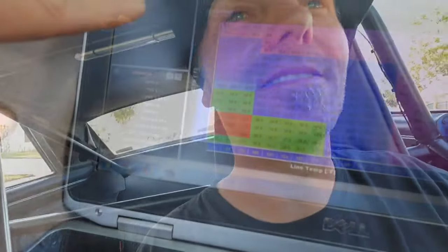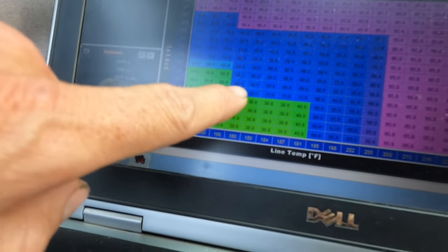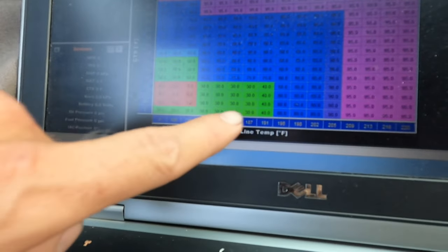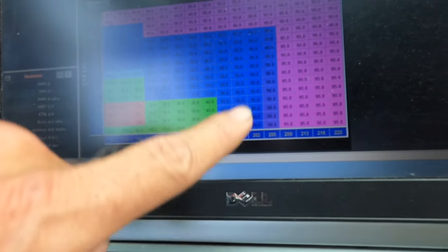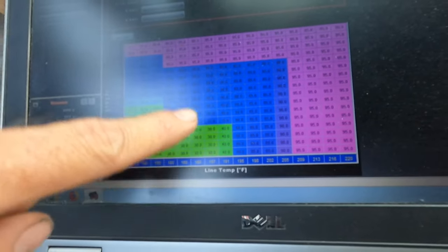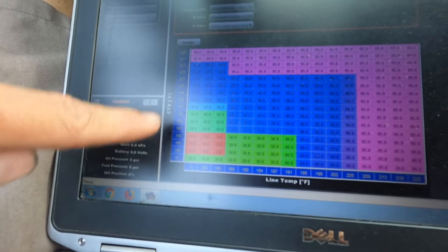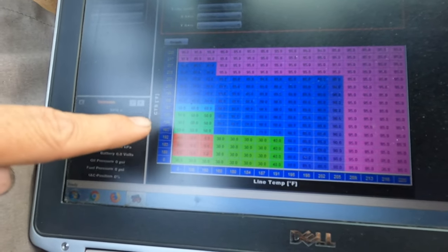I changed the converter and stuff's a little different now, and I don't have a commanding lockup at all. So I'd like to turn the fan on a bit harder or longer when it sees the transmission isn't doing so well. My coolant was hanging out down here and my line temp was higher, so it should have been firing pretty good. We're just going to make sure that when we're up in this temperature range at all, the fan runs hard. I'll lower the setting so the fan runs longer - that's going to be the fix.